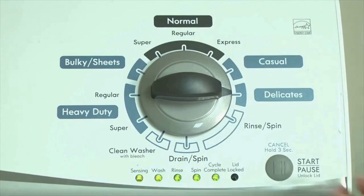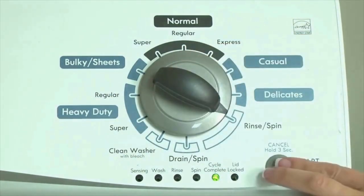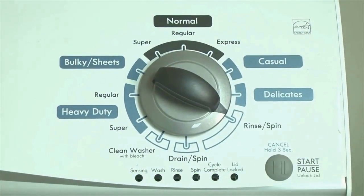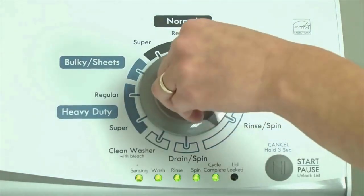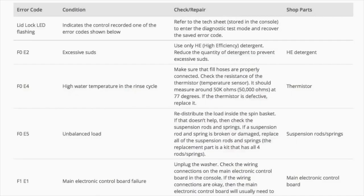If the status lights don't blink, try again and maybe try turning the knob a little faster or slower. Congratulations, now your washer is in diagnostic mode. Now we need to retrieve the codes — follow these steps to display the error code lights. Step 2: turn the control dial 1 click clockwise, then press the start button. Now you are reading the error codes. The control displays up to 4 error codes.